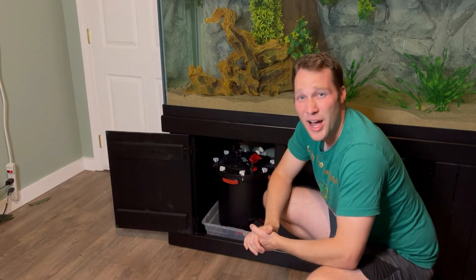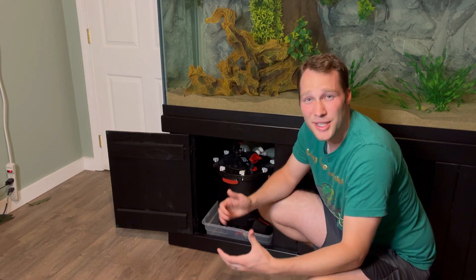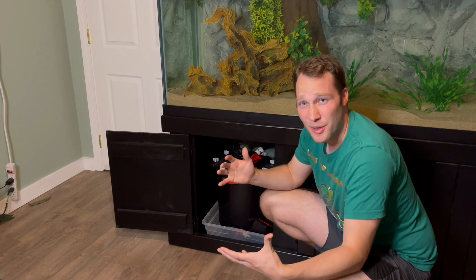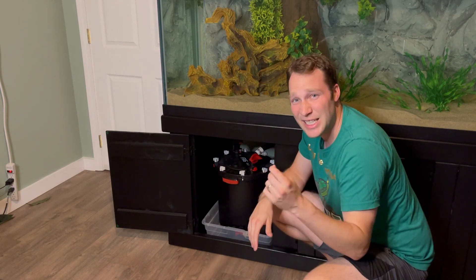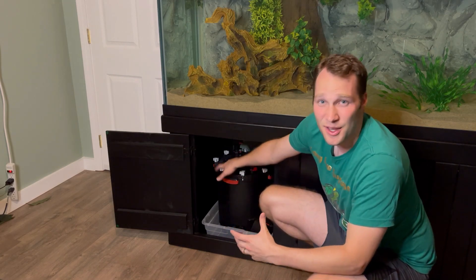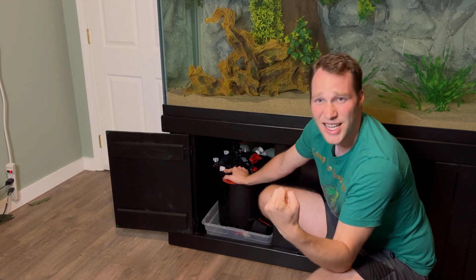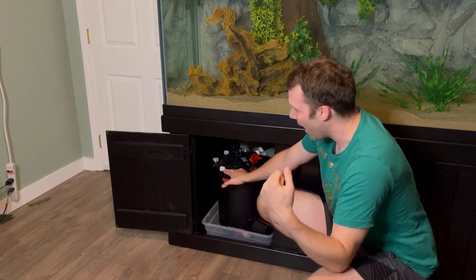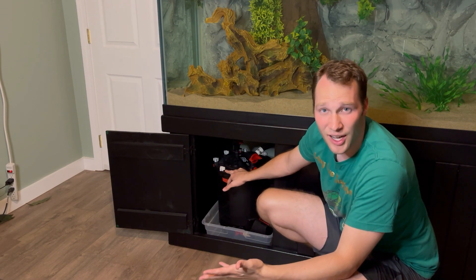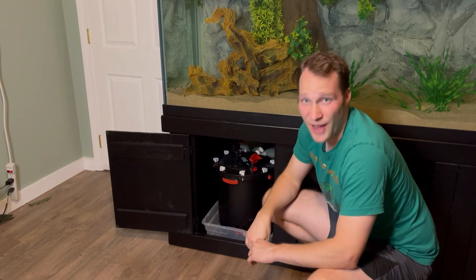Long live your turtle here. In this video, I'm going to be servicing my Fluval FX6. Why am I doing this? Because it's not working properly. What it's doing is it's pumping out a tiny bit of water when it's fully on and operational. That's not correct. The Fluval FX6 is known for pumping 900 gallons per hour. I'm getting like probably a quarter of a gallon per two hours. So that's not going to do it with this giant tank behind me — things are going to get dirty fast.